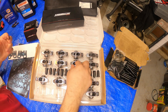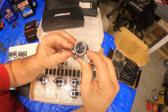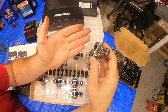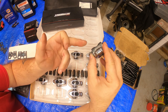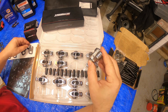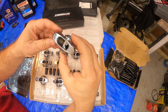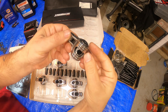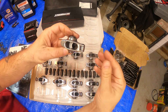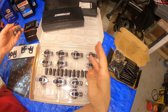The main star of the show are these 1.6 stainless steel rockers. Since we're switching over and getting rid of the self-aligning rocker arms because we're using hardened push rods and upgrading the studs, I was able to go with a 1.6 rocker. Right off the bat, super cheap - they had a promotional sale and I think I got everything here for around 200 bucks. That's crazy.